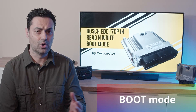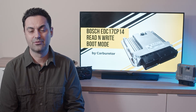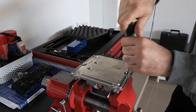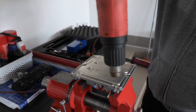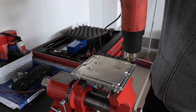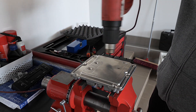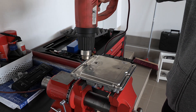To do this, you have to open the computer and put a boot pin inside. To open it, first we have to unscrew the bolts, then we have to warm it up a lot, because otherwise it is very difficult to open. After unscrewing the bolts, we take the hot air gun and start to heat it — from time to time we touch the middle of the computer gently and quickly.